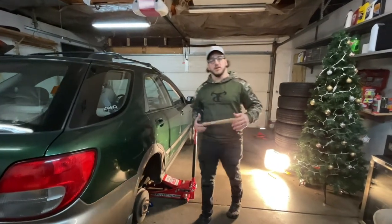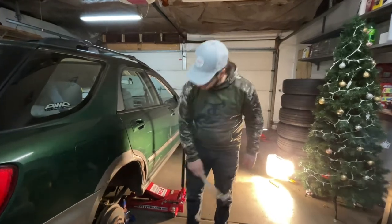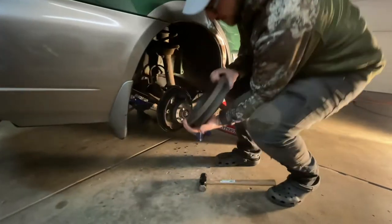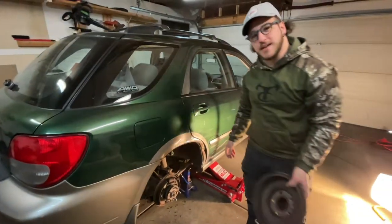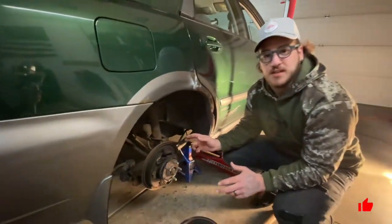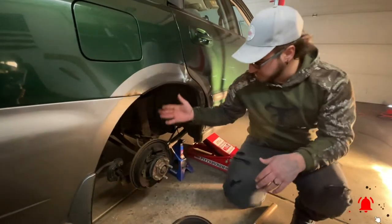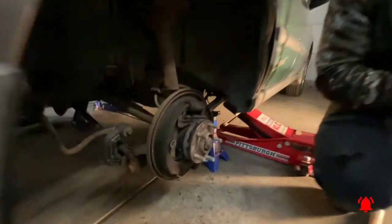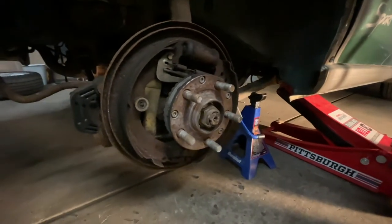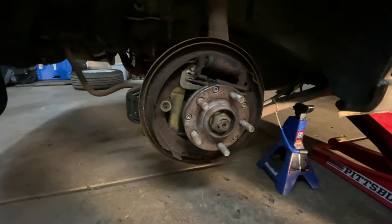So if you live in Michigan like we do, your drum brakes are most likely welded on with rust. Get yourself a nice big hammer and get that puppy right off. Nine times out of ten it will not come off that easily. When you're getting into drum brakes, it is always a good idea to have both sides up at the same time, because you're going to want a reference. You can take a picture of it all put together, but as you can see it's all dirty with no real color difference, and your springs aren't color-coded. So it's always good to have the other side jacked up and taken apart so you can use that for reference.